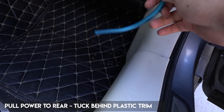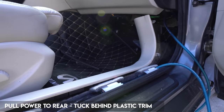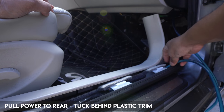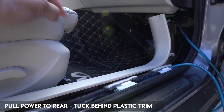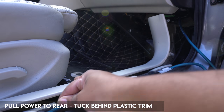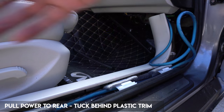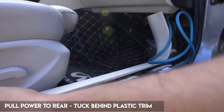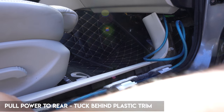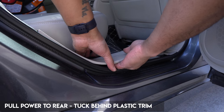The access just kind of guides the wire through the firewall, so the wire starts coming out underneath the glove compartment inside the cabin. Now I'm able to pull it through and keep running it back through to the back of the car. I pop off some of these plastic panels — once you pop them off there's actually a little channel with wiring already running through there. I just put my power cable in line with that wire and kept running it to the back. If you run out of wire, go back up to where it's coming in through the firewall and feed yourself a bit more.